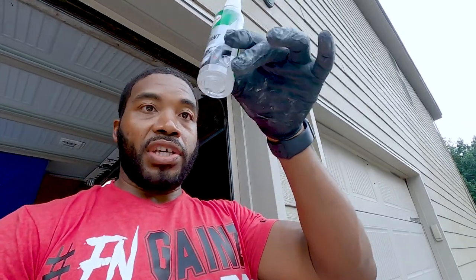I accidentally stepped on the front lip of the show car — but then again, we're switching to a JDM front so it's not that bad. Note about the Turtle Wax kit: whatever they put in the wet sanding lubricant gives extra protection so you don't scar the headlights. I've got a bucket of water with just a smidge of Dawn dish soap to provide a little protection while sanding. Dawn wipes away grease and grime and shouldn't leave any coating — just a very minimal amount. We've got progress.